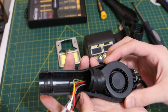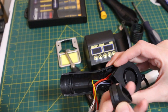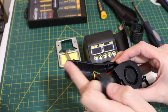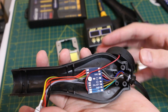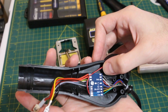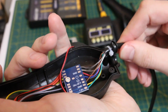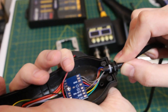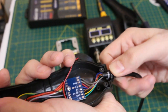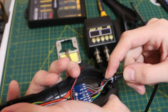Unscrewing the wires, we have the fan assembly — a very simple unit with a little rubber attachment to help guide the airflow from straight down instead of out here. The only other thing in here is a simple PCB, with all the wires coming in going on to the heater. The one weird thing is this cut-off zip tie — I'm not sure if that's what's keeping this grommet strain relief from coming out, but once it's together it seems okay. Worst case I'd hot glue it if it ever started coming out.